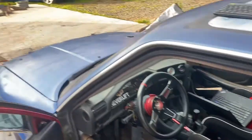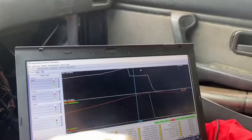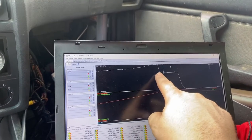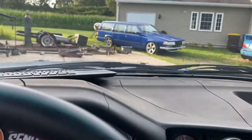Let me do my thing in here a little bit, get this thing a lot closer, and then we'll start trying to make more power. Did another pull to get familiar with the car. RPM is rising, boost pressure is rising — having an abrupt drop in boost and she stays at atmosphere until I let off the gas. So something blew off under the hood.